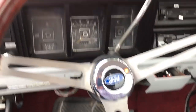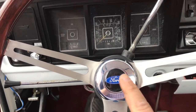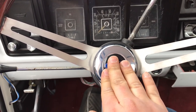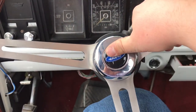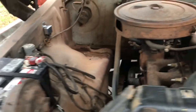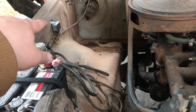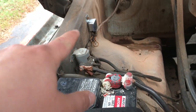I got the thing installed — she's on there looking good. I put the battery back to see if the horn works. I found the issue: I was pressing the button inside the cab and it was making a clicking sound. Found out it was the horn relay over here on the inner fender — the one I had was super old.